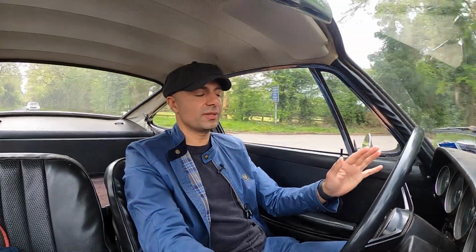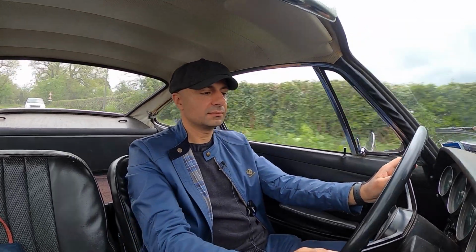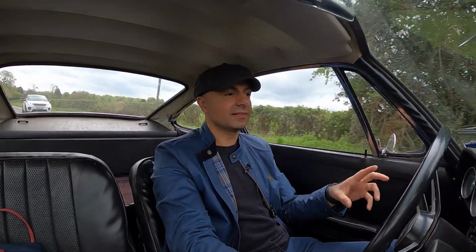I've got the idle screws set to maximum, so it's all the way down, so I'd need to make some more carb adjustment to get it any lower. But right now it drives so much smoother than before. The seat is still pissing me off because it's clicked again, and yeah, it's a little bit labored. 1500 revs in 5th gear, so I'm going to go 4th. But anyway, it's a bonus to be out for a drive in it.